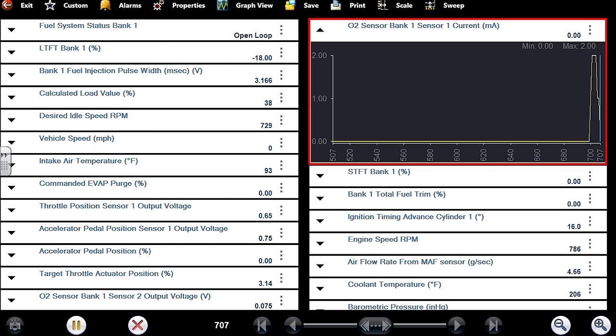That's weird — all that hash in there on a snap. That's without peak detect — this is width. It shouldn't look like that even with peak detect turned off. Let's go to the graphing meter. Four-volt peak — I've been teaching that forever. There's a lot of hash in there. Back to the lab scope.